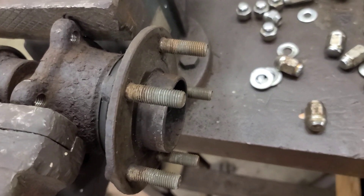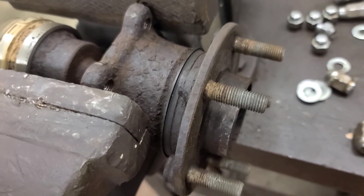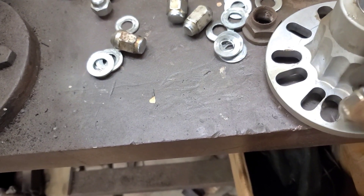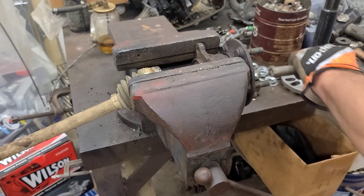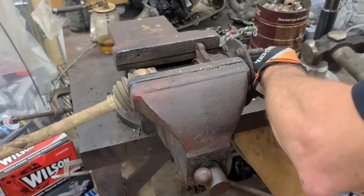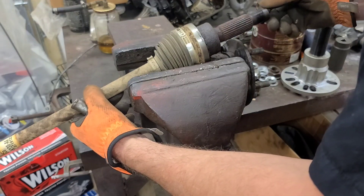We'll have to see how badly damaged the end of the axle shaft is. Obviously if you had to put the nut in, you would have only been able to push it in about an eighth of an inch before the nut bottomed in the housing and you'd have to take it apart and remove the nut. Nevertheless, it did work — a tremendous amount of force from this tool. What makes it better is if you use grade 8 washers, because the wheel nuts are tapered and spread these slots. Even with three washers, I wasn't using hardened washers. I'm going to tap it out the rest of the way with just a hammer, punch, and drift. The axle is out — they are no longer married. The axle shaft is a bit damaged on the end, but I've seen worse.